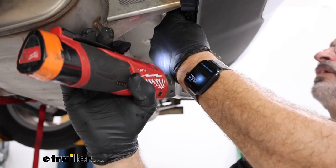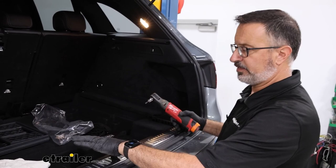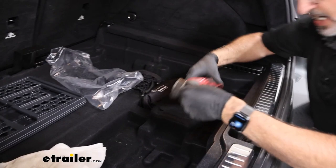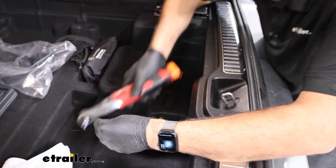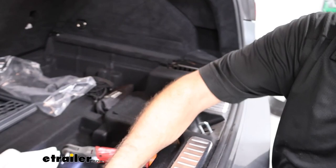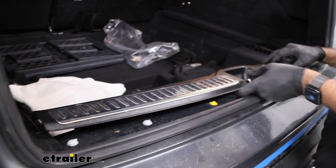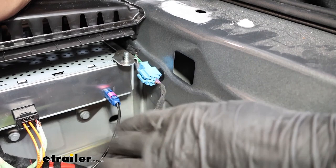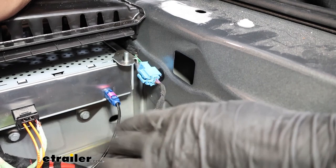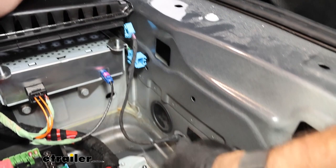Towards the middle — it's the same as the other ones — and you have the same exact setup on the passenger side as well. Now open up your rear hatch and get your floorboard out of the way, which is what we've already done. Grab a T30 socket; we're going to have a T30 screw here holding this rear scuff panel in. Once this is out of the way you can start by prying gently on either side — you're going to have plastic clips all through here holding this down. These are the clips we'll be pulling out and putting back in to snap it back down. The reason we're doing this is there's a wiring harness — you're going to see a tiny little tab at the edge; push down on that and it'll disconnect the harness.